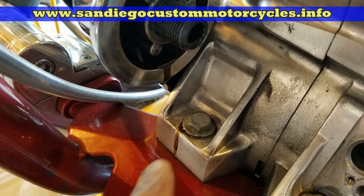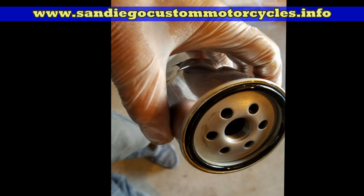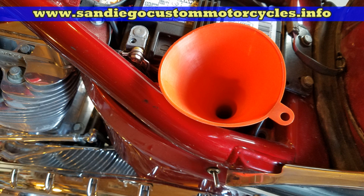Afterwards there's always a little oil that seeps out — that's all that came out. Clean everything up, make sure you oil the o-ring on the new filter you're going to put on. When you put it on, snug it up by hand and maybe go a quarter turn more. You don't want to go gorilla on it — it doesn't need it.